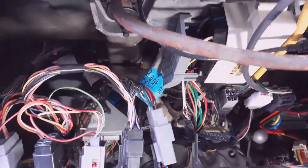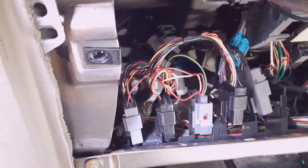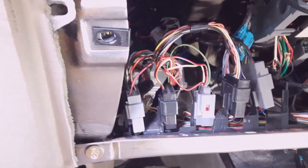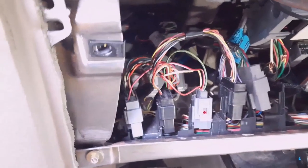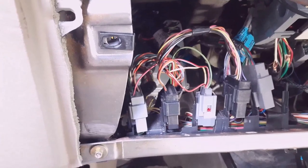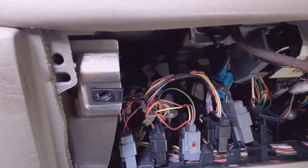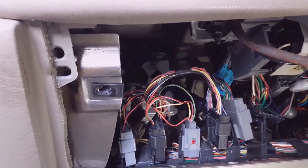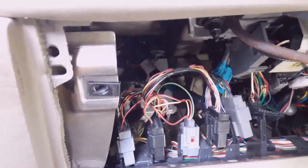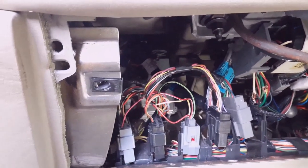My parking lights on this one are a little difficult. Normally your parking lights are a positive or negative wire coming off the switch and you can just tie your remote start wire into it. But this vehicle requires you to cut that wire in half and then do a relay so you don't get any feedback — depending on whether you have automatic lights or not. This is going to be a little difficult if you've never done this before. I'll try to explain it or post a link. You might have to cut two wires — I'll know once I take it down.